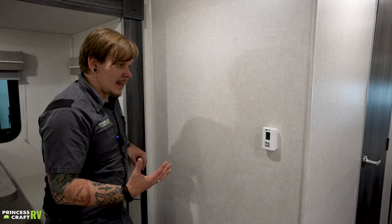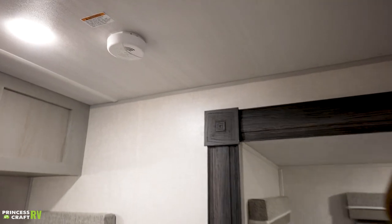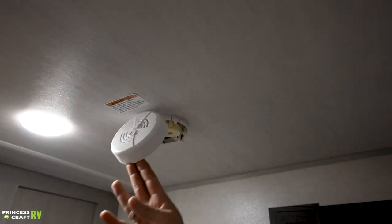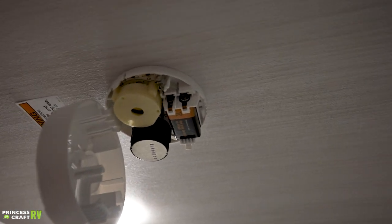In the event the furnace sets off your smoke alarm — located up here — in that first 15 minutes of operation, that is 100% acceptable per the furnace manufacturer. Every time you light an RV furnace it's like lighting it for the first time; dust has deposited on it going down the road, and efficiency improves as it continues to run. While we're here at the smoke alarm: test your safety equipment every single time you take the unit out. This is a nine-volt battery-driven smoke alarm just like you'll find at home. Keep a spare nine-volt battery with the unit in case it starts chirping — we can never recommend removing that battery, so make sure you have a spare to replace it.